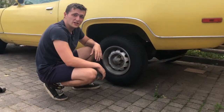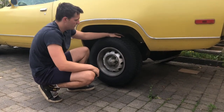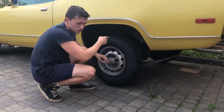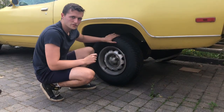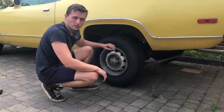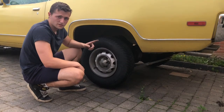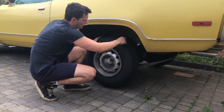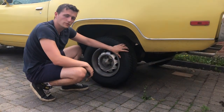The gist is that with a limited slip differential both wheels turn exactly the same. So the way you tell is if you turn this wheel, that wheel should turn if it was a limited slip differential. But with mine, as you can see, it's not going anywhere, which means we have a non-limited slip differential. Just as a note, if you go in reverse the other wheel will turn whether it's non-limited slip or not, so don't get your hopes up.